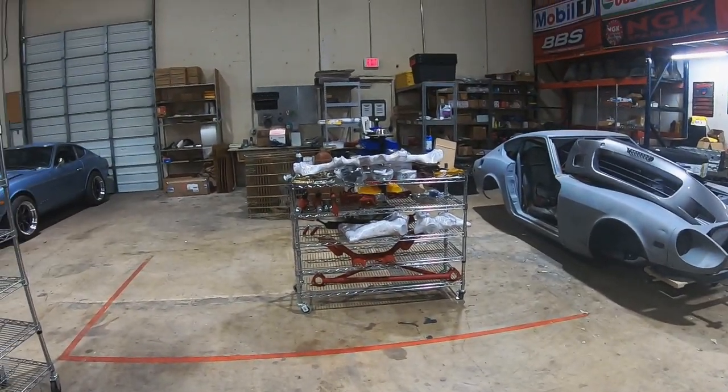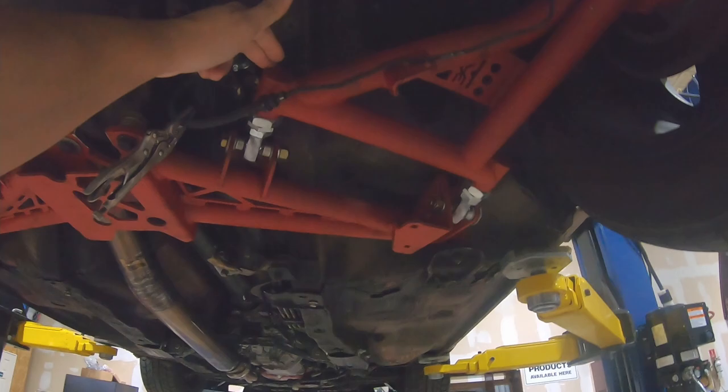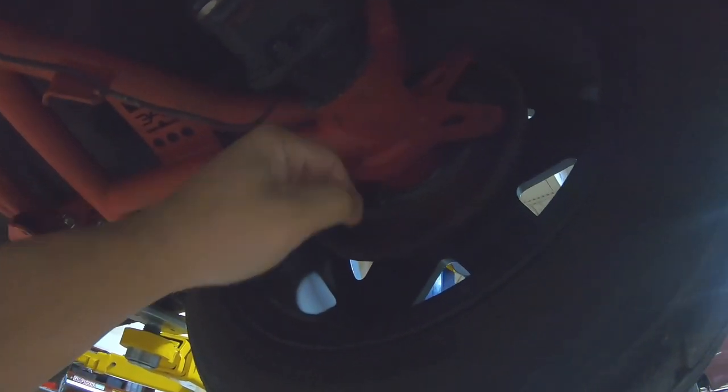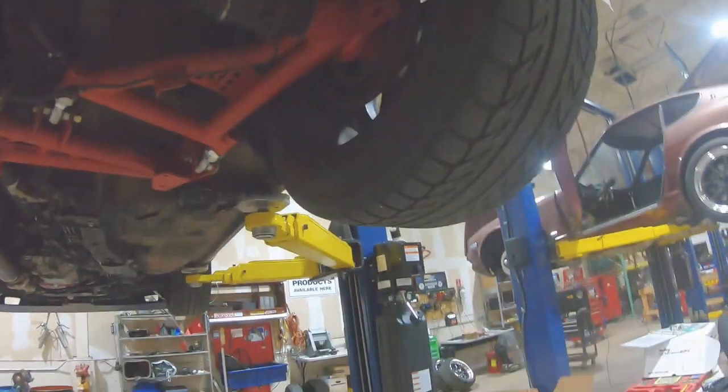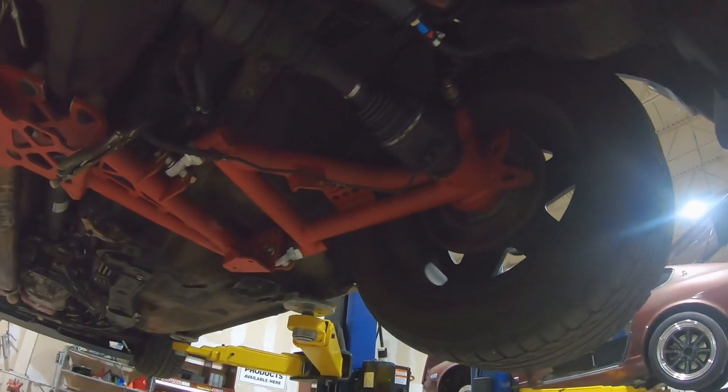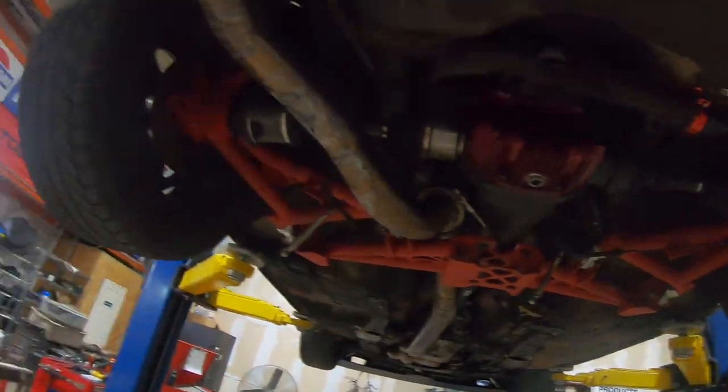Just to recap — this needed to be notched or clearanced for the rear diff. Long story short, it hit the diff case, so I notched that temporarily. Once we unpackage the new one, we'll see exactly what changes were made. The control arms for the most part fit much better. The only major issue was this was about a quarter of an inch too far forward, so the Techno Toy bracket was hitting the rotor and even the factory brakes were still hitting. We're going to yank this whole setup back out, swap my bearings and hubs over, put the new stuff in, and see how much better it fits.